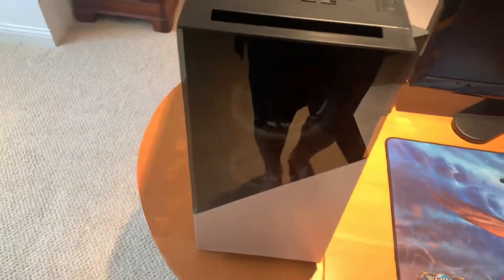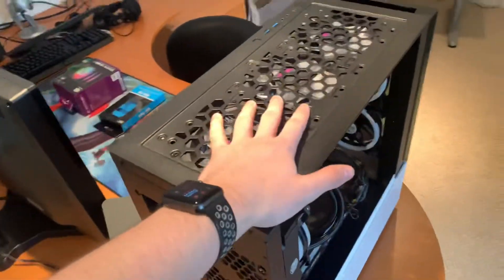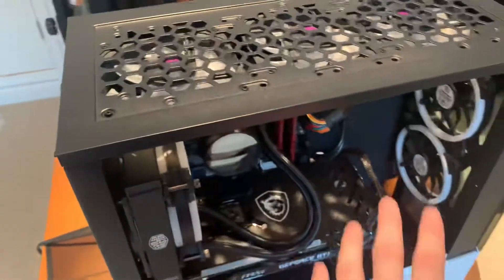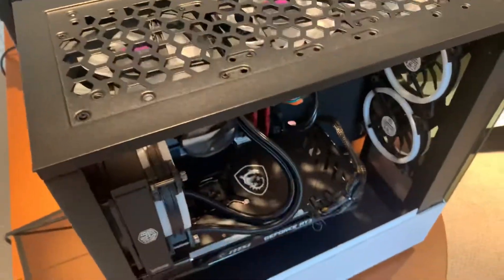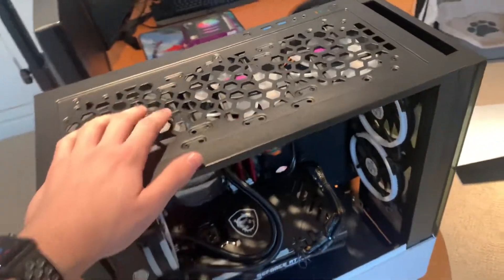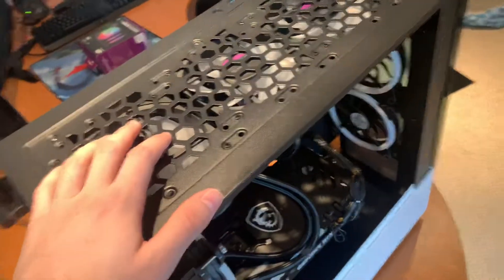So that's what I did, and I would recommend doing that definitely if you bought this computer. It runs pretty hot if you play a graphically intense game for a little while, and the side will start to feel very hot on this glass piece. But really, you can apply this kind of knowledge to any computer. As long as you think about the principles — if you look at your fans and know that these are intake, and you realize that there's a lot of hot air here, hot air rises — you take three exhaust fans and have them blowing hot air out, it really makes a difference. My temperature changed by about 10 degrees Celsius, which is a very big difference. I was hitting 90°C playing Assassin's Creed Odyssey for only about 30 minutes, but when I added these fans I was able to play for hours and never pass 84°C, which is hot but optimal, especially for a graphically intense game.